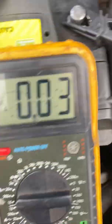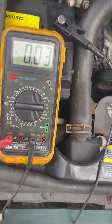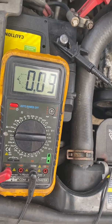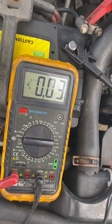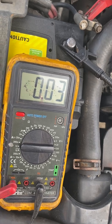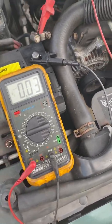Keeps all the memories alive. And then you look — so you're losing 0.03 of an amp on this car, which ain't bad at all. I think 0.2 of an amp is probably the maximum you're going to want to lose. Bear in mind that a small bulb like an interior light will pull about 0.7 of an amp. So 0.2 of an amp at the very most would be an acceptable drain. Above 0.2 of an amp, you're going to want to start pulling fuses and see if you can isolate a circuit.